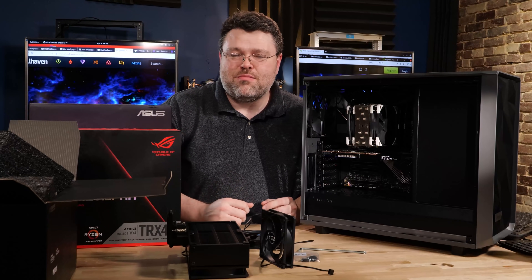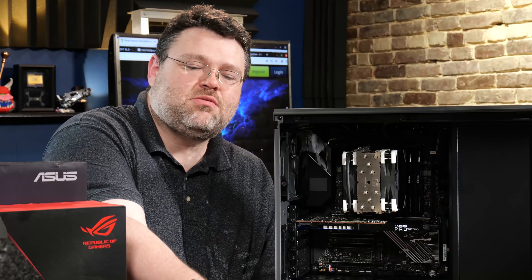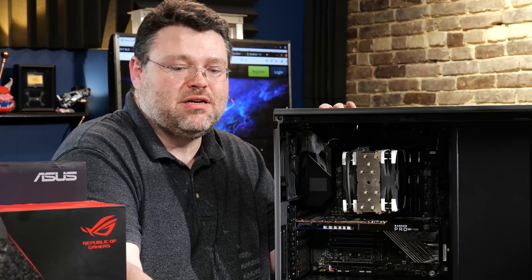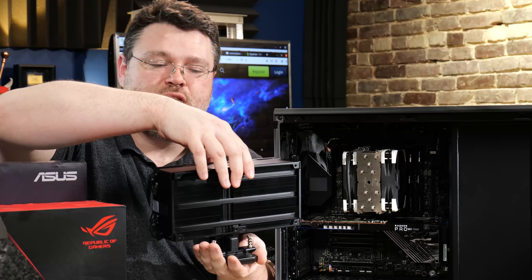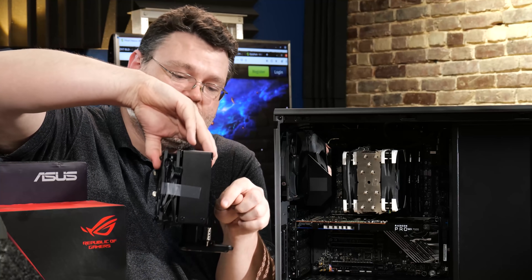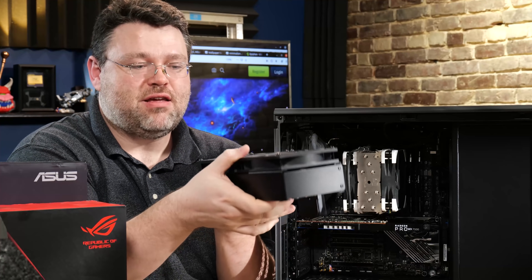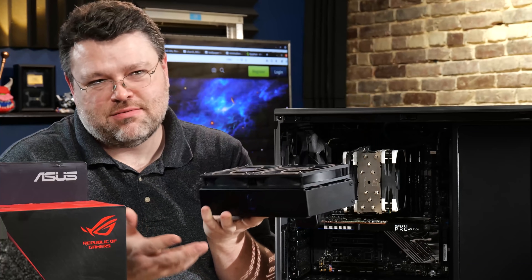You still don't technically need a Thermo Siphon unless you unleash the beast with PBO. With Threadripper Pro, this would have to be oriented like this, which won't help unless you're in a desktop case rather than a tower. This will work perfectly fine horizontally. Make sure your setup is level because gravity has to pull the liquid down to the hot spot — that's why it has to be mounted this way, so gravity pulls the condensed liquid back to the part that's getting hot.